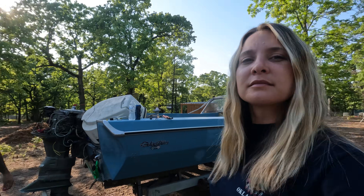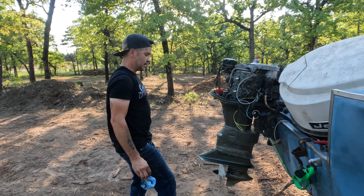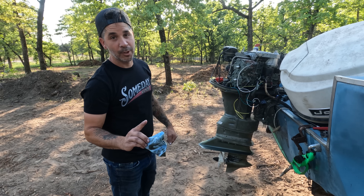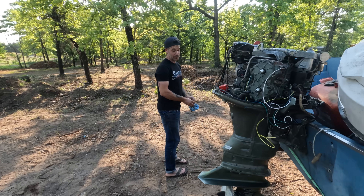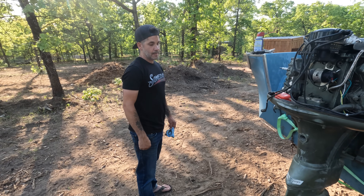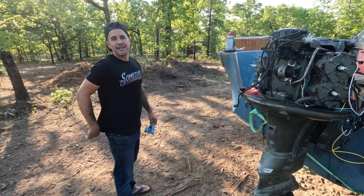At the end of the day Jason's done a thing or two with the boat. New battery. I drained all the oil from the lower unit and put in new lower unit oil. What was in there was not right - at least color-wise it looked off, maybe it had just been in there for 50 years. It's supposed to be green but it was red.